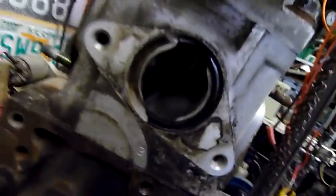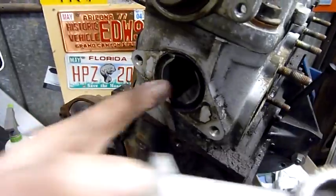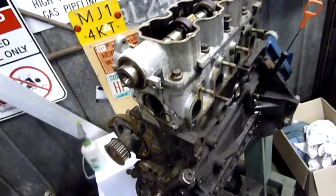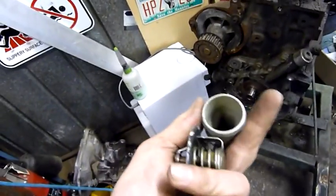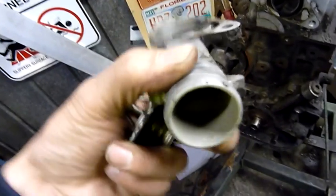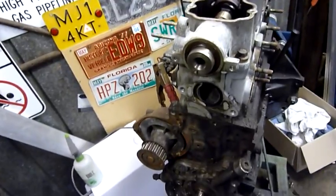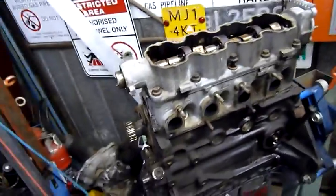Inside the head is spotless - there is not a speck of corrosion in there, maybe a tiny bit, but I've seen a lot worse. It's not red with iron oxide, the block hasn't rusted, it's pretty good. The thermostat housing is good - it's not all pitted around the outlet, just a couple of tiny corrosion marks, probably just from sitting open in the weather. The cooling system on this thing was fine - it never failed, never leaked.